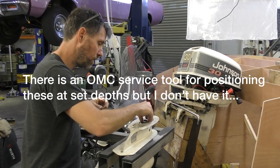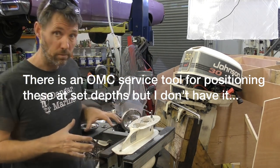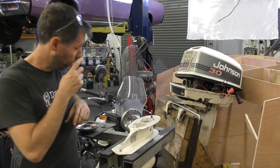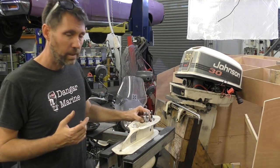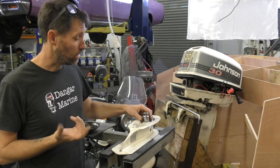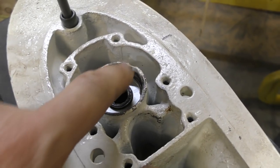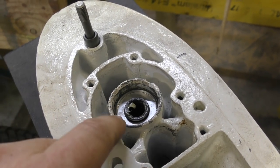First one going in spring side facing down. That one felt really good going in — every tap moved a little bit so it wasn't hung up anywhere, but it still felt quite snug, so I'm not expecting any oil or water to leak around the outside of it. Next one popping in spring side facing up. You need to be a little bit more careful when putting them in spring side up because you're pressing against the edge of them, so just make sure it stays aligned. There's a bit of damage to the edge from corrosion but it's well above the oil seal so it's going to have no impact on how well it seals.